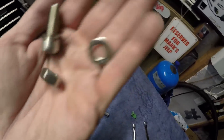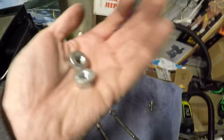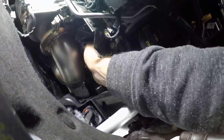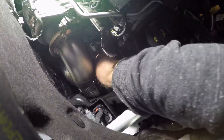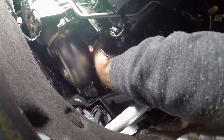Ultimate Racing did include nuts and washers for your upper bracket, but since I have a stud I'm just going to use my stock nut - these won't look like your stock ones since I replaced the stock with better ones, the stock were too soft. Of course there's no bracket on the other side so I won't need the other nut. This bracket is even easier to get to than all the other downpipes I've had because the downpipe angles more toward the back, giving you a perfect open-end wrench spot. The stock downpipe totally blocks that nut, but this one is easy to get to.